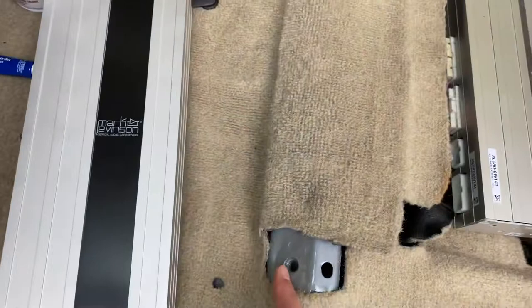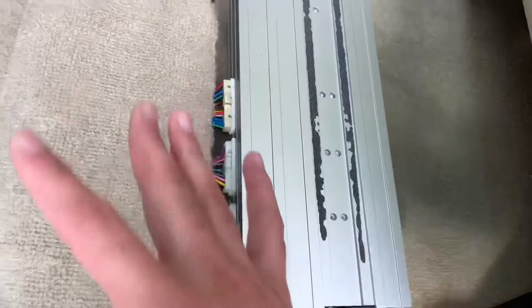The first thing I did was I removed the front seat — I just kept the harness attached. You don't want an airbag light. It's just two 14mm bolts in the front and two in the back, and then you have clear access to this. There's usually a bracket and stuff, but I already removed that. I also took off the Mark Levinson strip to expose the bolts.